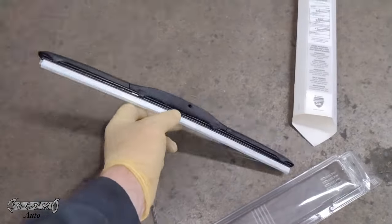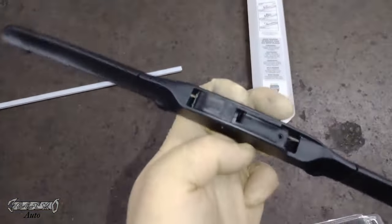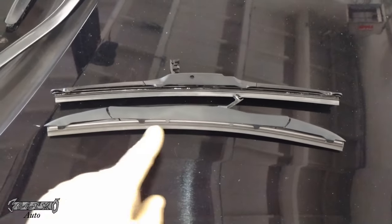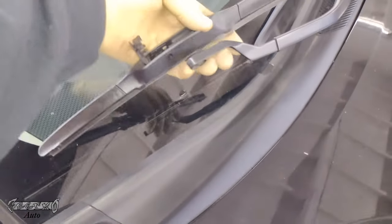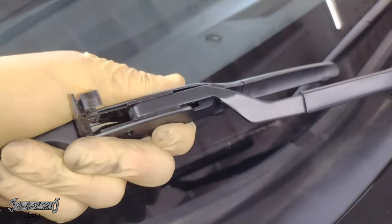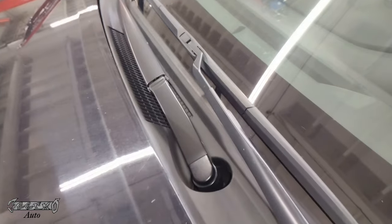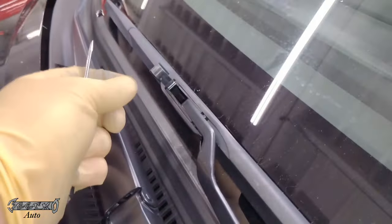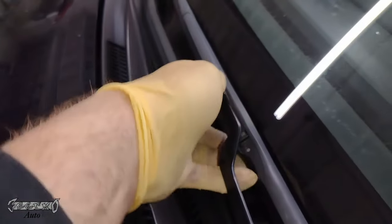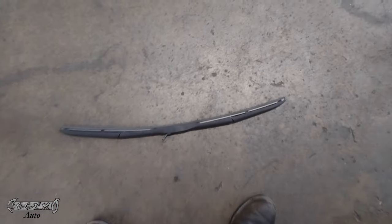With two hands it's a lot easier. Put the new one on — this is a 14 inch. Take off the white protective cover if yours has one. Lift the locking tab up, then match up the size to make sure it's correct. Go ahead and put the wiper arm straight in, then drop it down so it hooks in. Pull it towards yourself and it'll lock into the hook, then shut the locking tab. Toyota tries to simplify wiper blades as much as possible, which I like.